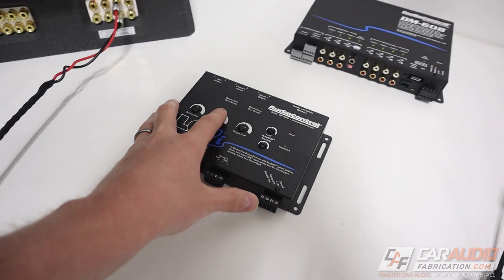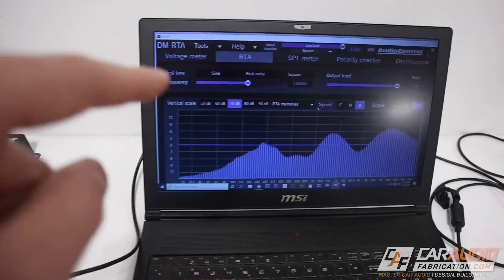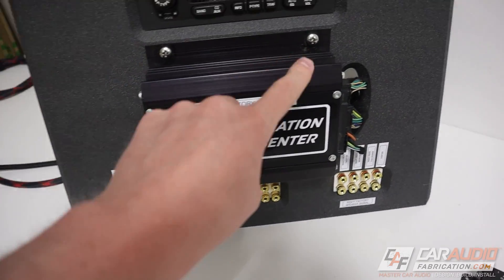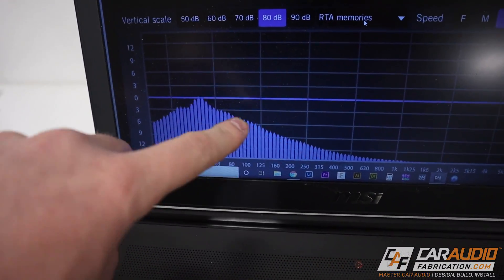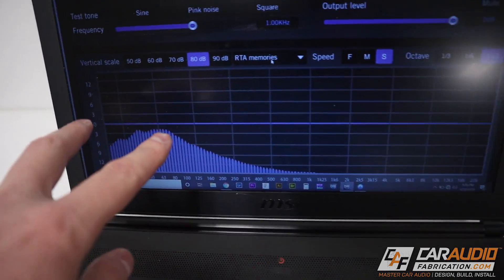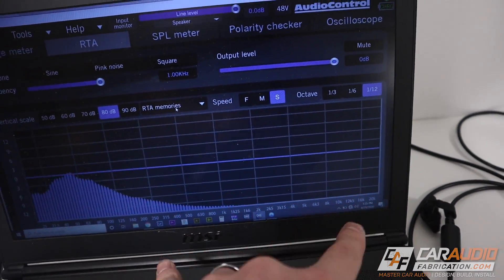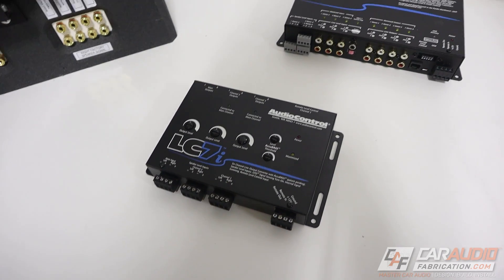The reason for signal summing is so that we can add that rear speaker signal to the next signal I'm going to show you. Now we're tapped into the separate subwoofer signal from our factory amplifier, and you can see that this brings in our lows. So if we did want to add something like a six by nine speaker to the back of the vehicle, we not only want these lows, we want the mids and highs as well — everything added together. That is why we need a summing device.